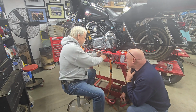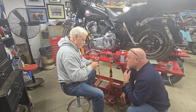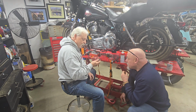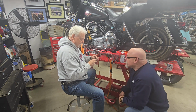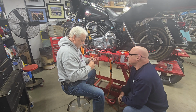You know what? We're getting ready to start putting the drain plugs in and make this thing wet. And drain plugs are kind of ignored by most people. Stick them in, pull them out, and they're an important diagnostic tool. Amen. Little magnet on there, right. Little metal on it. So before you put them back, you want to make sure they're nice and clean. Yeah. And I noticed you changed the O-ring.